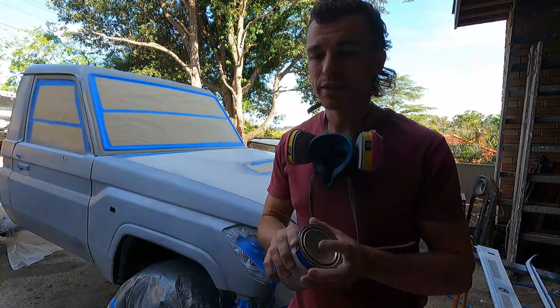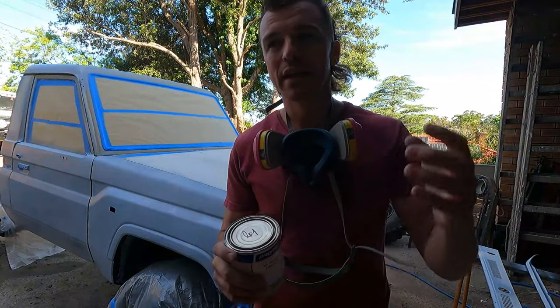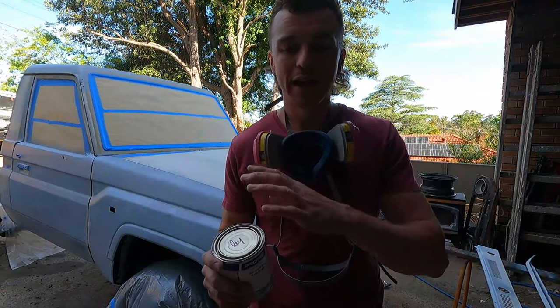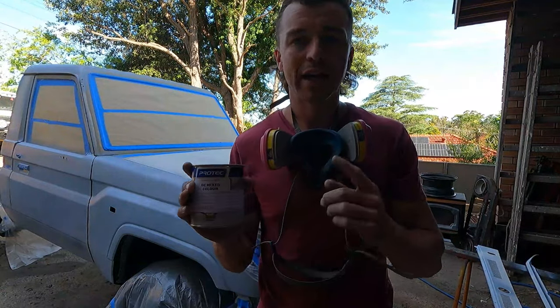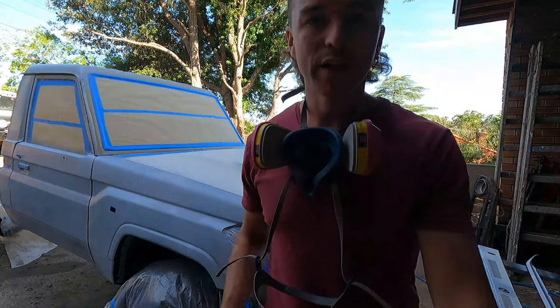Basically with Raptor, the way you do it is, they come in 1 liter bottles, but they're about 710 mils or something, and then you add 280 something mils of hardener, and then you add 100 mil of the color, because this is a tintable kit. Shake it up and chuck it on the gun.